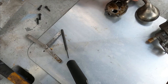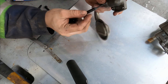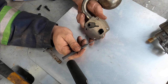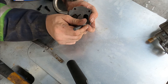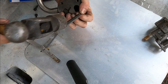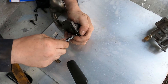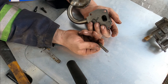The one thing I'm going to show you now is the oil pressure regulator spring and pin. You can see the pin comes all the way through. A lot of people wonder how to get it out — undo the four bolts, then bang it through from the same direction it's going to go back in. After a couple of taps, it comes out, and out comes the spring. These springs are rated, and you can buy replacement springs for Chevys, Fords, and Chryslers.